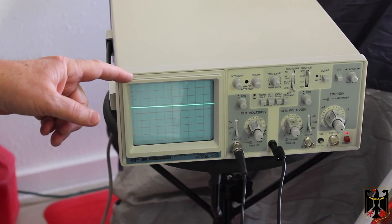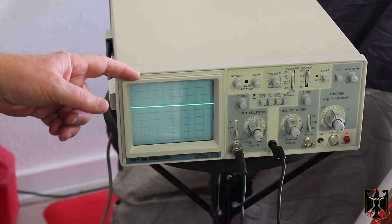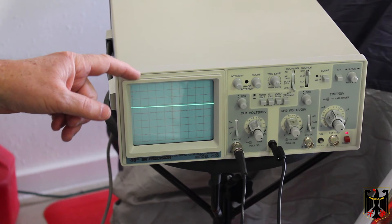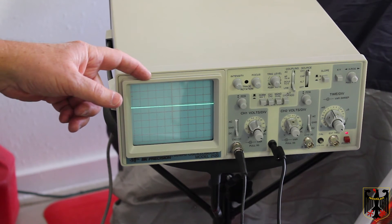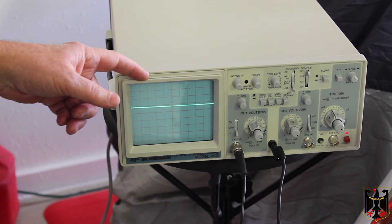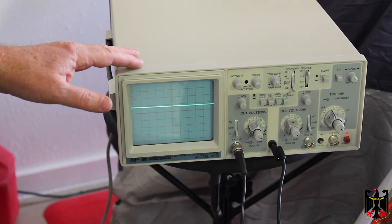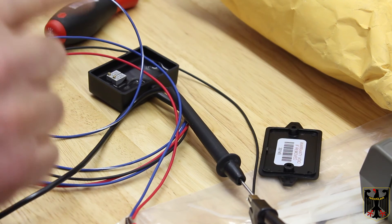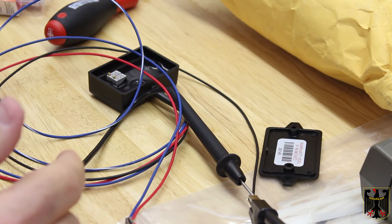The one thing we'd really need to do is take it out on the road and see what kind of voltage it gets at higher RPM. I'm not sure exactly how to set that up, so I may just install the clamp at 4.85 volts, take it out for a test drive, and see what happens. I'm getting ready to adjust this clamp and I think we're going to set it to about 4.8 volts.